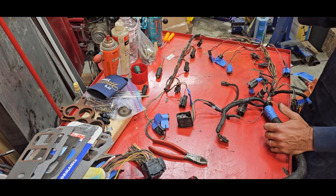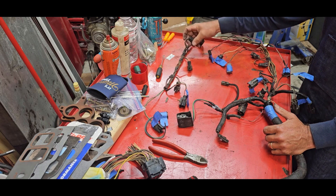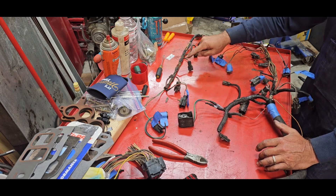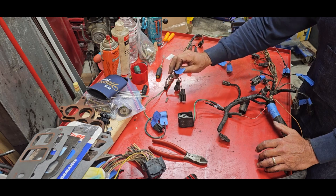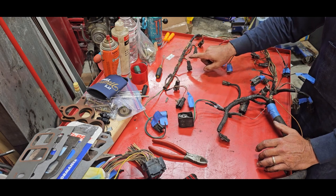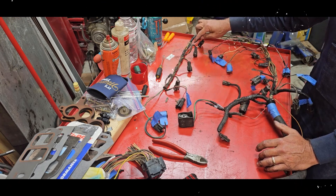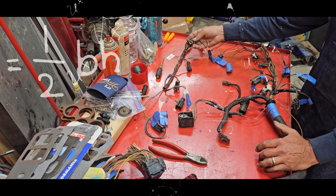So there's basically injector one and injector two. The tan wire is pin 58 — injector one. The white wire is pin 59 — injector two. I'm going to leave that one tan; pin 58 will be injector one. This other one is injector two but it's tan, so I'm not using pin 31, which is part of the EGR system. I'll move it back, repin it, and stick pin 31 — which is at the 60-pin connector — and move it to 59. Then pin 59, the white one, I'll move to pin 12, which is injector three in the computer that Stinger makes.